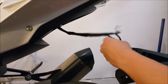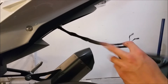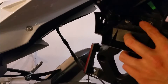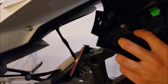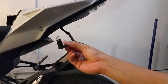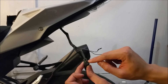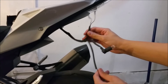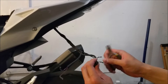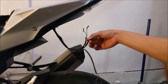I went ahead and pulled the whole bulb assembly just to take a look at it before I cut anything. This whole bulb assembly kind of just slips out from the housing on the back. The whole bulb has a rubber grommet that locks it in place — you just pull it all the way out. So your light bulb looks like this. What you want to do is cut somewhere as clean as you can. There are two wires here: the brown is the ground, green is the positive. The short one is going to be your right turn signal, the longer one is your left. Cut it right here.